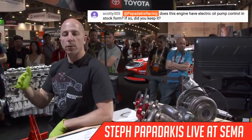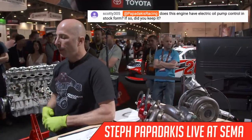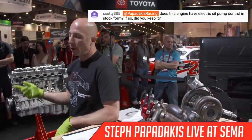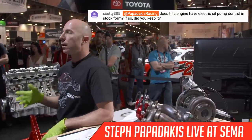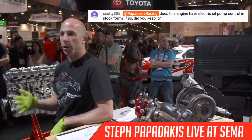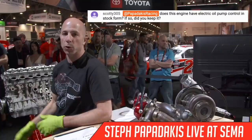That's a bit conservative. That's quite a bit of oil pressure. But as we ran it a couple days on the dyno last week and pulled it apart, all the bearings look perfect, like brand new still. So we're going to stick with that for a little while. And that's one of those things, like the newer technology, at first you're like, oh man, what are they doing? This is so complicated. But once you learn to control it, you can appreciate it, because now we can get whatever oil pressure we want.